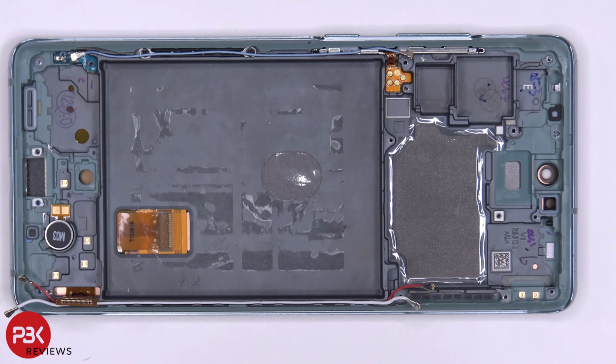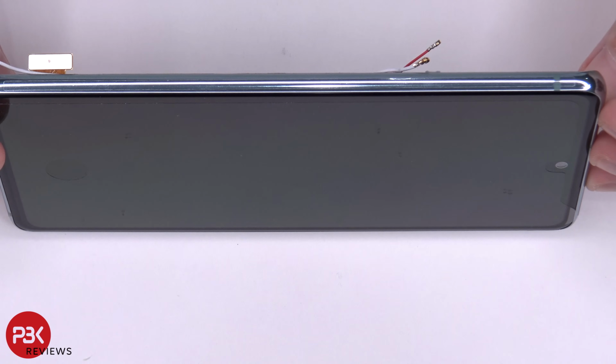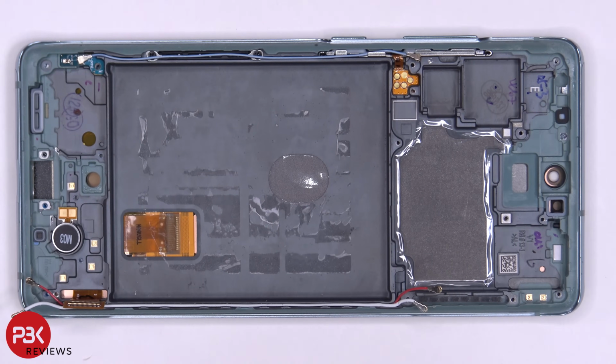As far as replacing your screen goes, you'd basically have to remove your back plate. Remove the screws on the bottom portion where the speaker assembly is. And lift up and remove your speaker assembly. And then you would have access to disconnecting the cable for your screen. Then all you'd have to do is heat up the front where the screen is, so you can loosen up the adhesive holding it down. And then you'd pry your screen off. You'd apply your new screen, reconnect the flex cable, and just reassemble the phone.